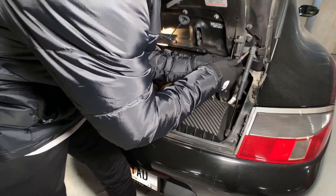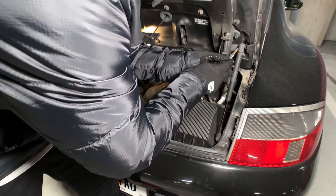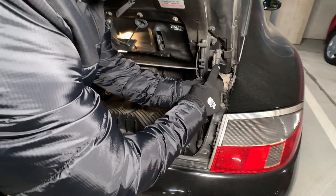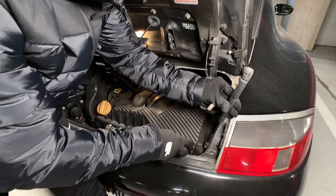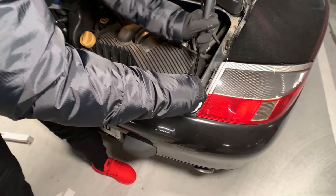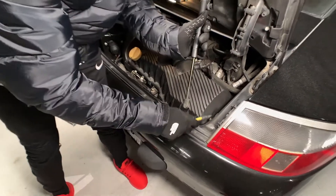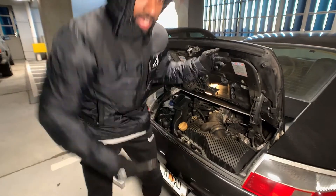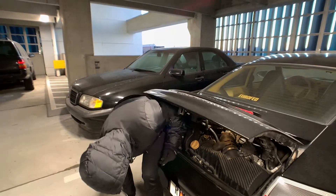So here's how it's done. You pop the trunk open, then you take a flathead screwdriver and reach down in here and get under this tab. There it goes — that one's off. Now get the bottom one off the same way: reach under the tab and pry this little brace off the ball joint right here. Once you get this little brace up, it just pops right off.